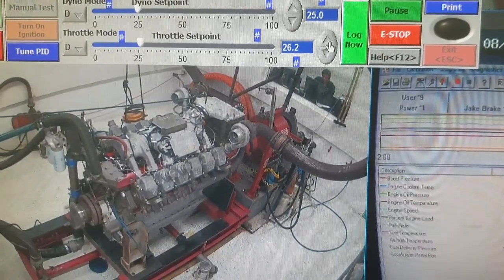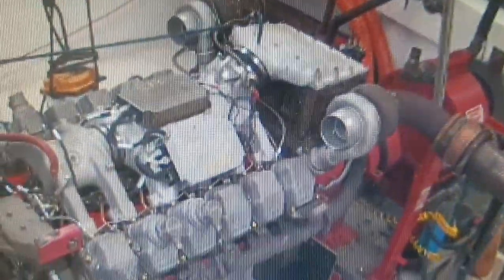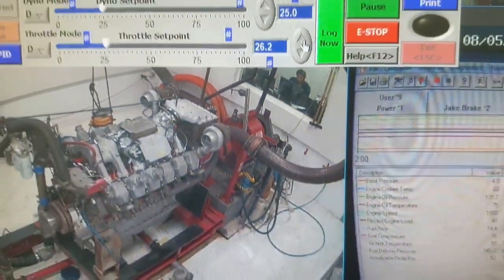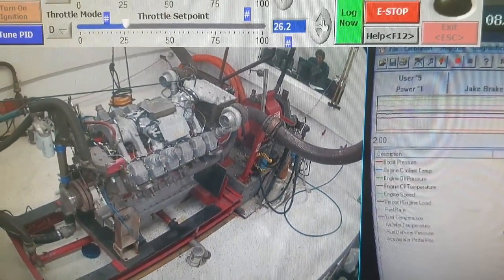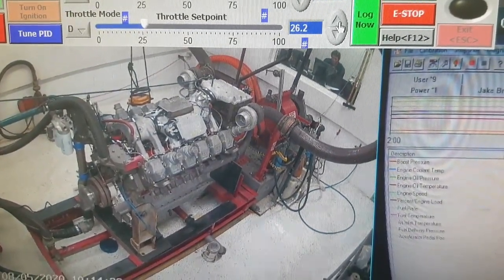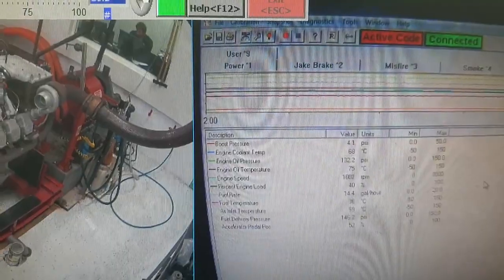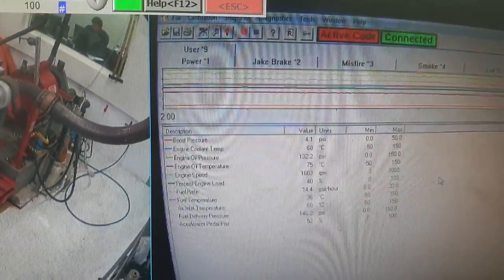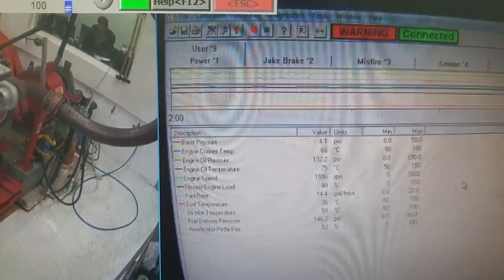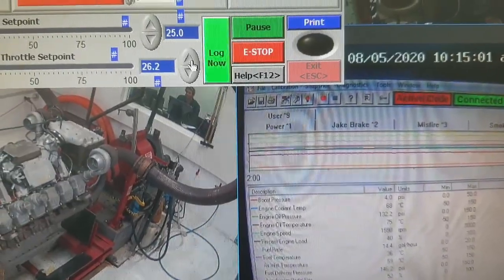This is running a DDEC3 system, so this shows how old it is. You can see the two Detroit boxes on the top there — DDEC3 boxes. I personally think these are probably one of the most reliable electronic systems they made, the DDEC3s. From my experience, they tend to hold up pretty good in the field. They have their problems, like everything — that EEPROM memory failure can come up — but they do have a lot of redundancies. They can put up with a lot. You can have a tacho fault and all sorts of things going on in the dash, but they do tend to keep going.